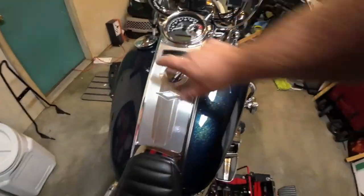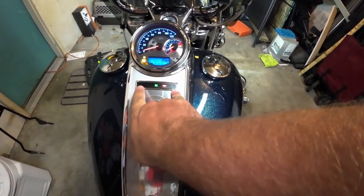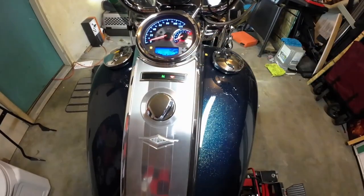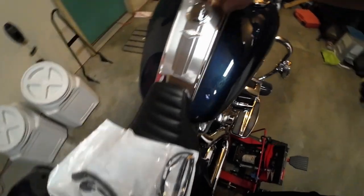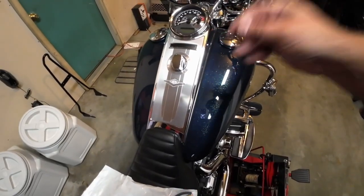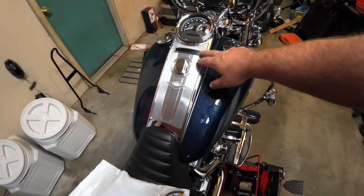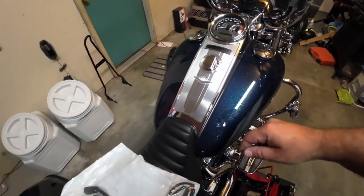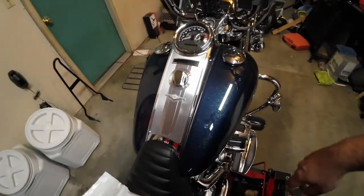While in Florida, one of the biggest problems I had was the green blinker indicator on the dash. You can see there's no green indicator — turn on the left blinker, it's flashing, but no left blinker showing on the dash. While we were in Florida it rained like crazy the first night, and that caused the problem. We heated it up with a blow dryer to try to get all the water out, and it still didn't work. This part is about 70 bucks — not horribly expensive.